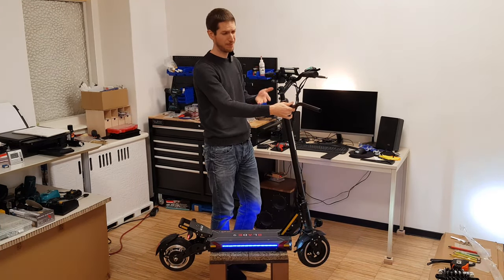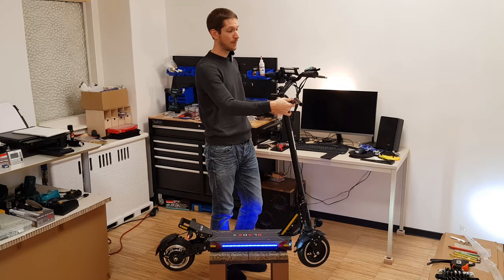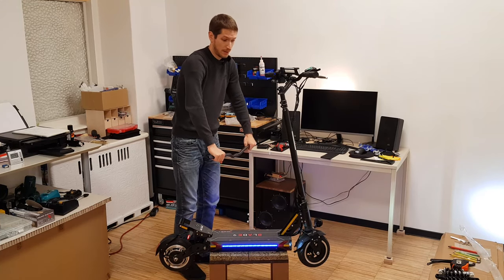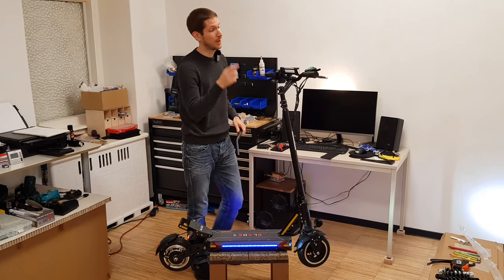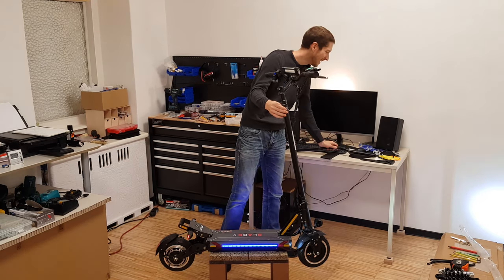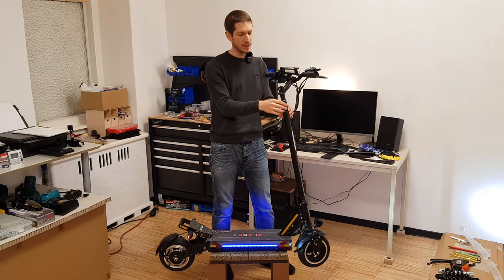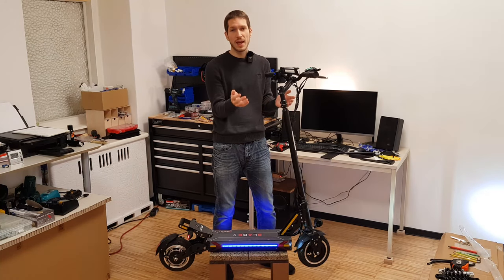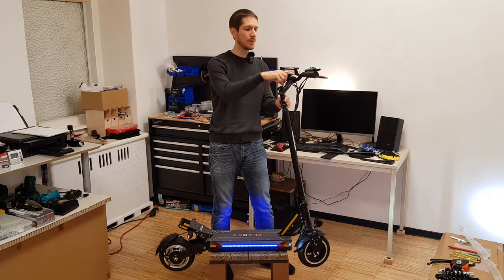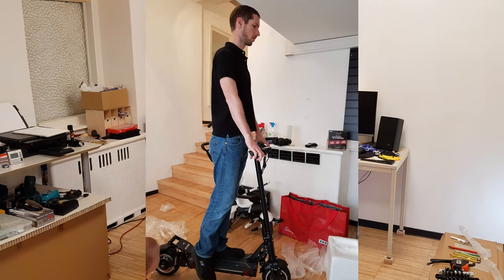With the original handlebar position, it was like this — too low and too close to my chest — which was not very comfortable and I couldn't stand on it for long. But the good thing about the Blade 9 is that it can be tuned a lot to your liking. The handlebar stem ends up in a 28.6mm diameter part which can fit with almost any normal handlebar adapter, so I have a part that makes it longer, higher, and a little more out in front.